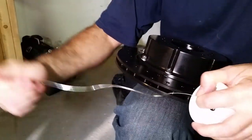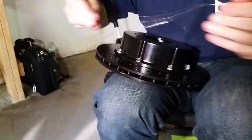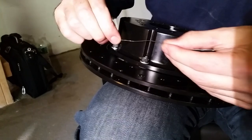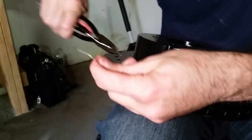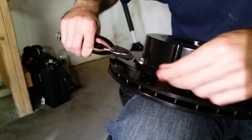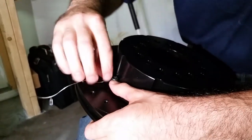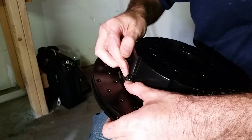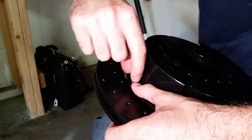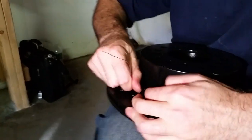We'll start it up — very simple. Grab your piece of wire and snip it. Feed it through the bottom and come up. Pull it tight and measure. When wire tying, you have to make sure that the wrap-around side of the bolt when you twist your wire is on the bottom side, so the wire doesn't come loose and come over the bolt. When the wire tie twists, the wire goes downward, not up over the bolt. The wire is nice and tight.